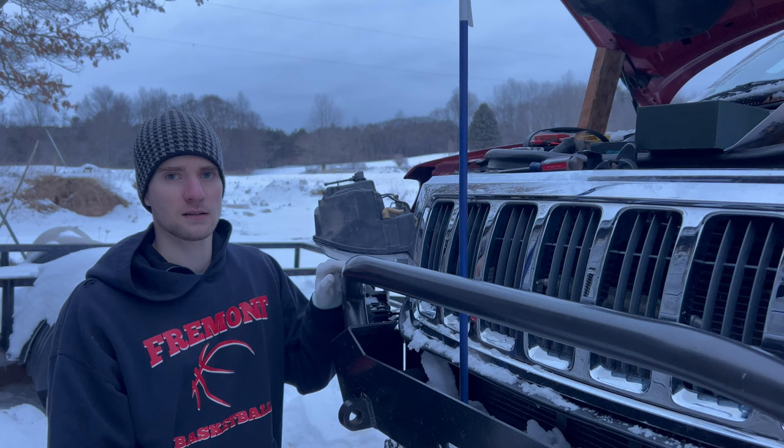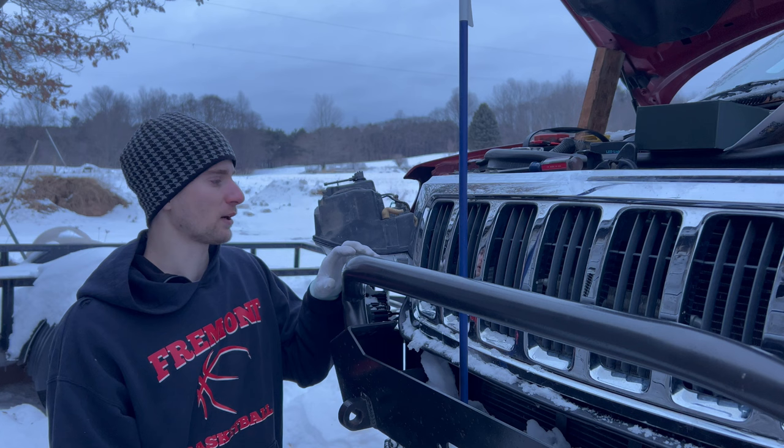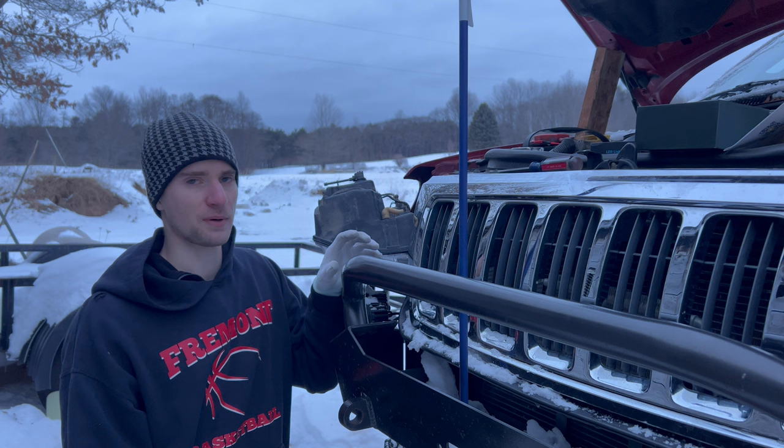Over here on this other side, I did have a bit of a weird problem with the blinker. When I would plug the bulb in, it was not working at first, and what I ended up having to do was pry out each contact a little bit. I did not notice a problem with the factory bulb, so I have to assume something is up with this Auxito bulb.